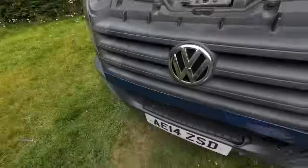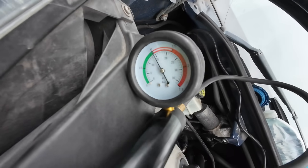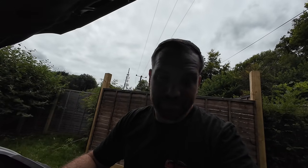The second fault we've got on this van - I've got the pressure tester out. That's been on there about 10-15 minutes and hasn't lost any pressure, but he's having to top up a few litres of water by the time he gets 10 minutes down the road. I've done a block test and it's passed - it's not leaking coolant anywhere. I'm at a loss. I'm just going to have a look underneath and run it up to see if I can see it actually leaking under pressure.